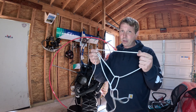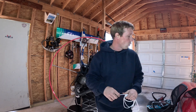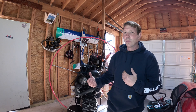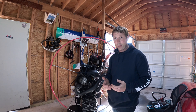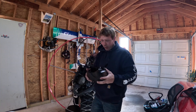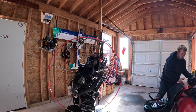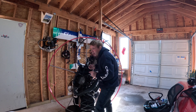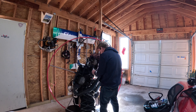I'm ripping down the motor and we're going to put in this new pull cord that I just bought from the hardware store. I was going to order from Vittorazi or from another paramotor company, but I figured just to get a local store cord, maybe a little bit beefier than the one that's there now. I'm slowly taking this paramotor apart to get this motor off — air box off first, then we're going to try to get this fuel line off using a needle nose and a flat head.